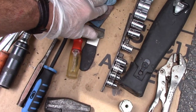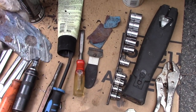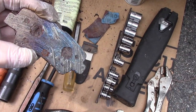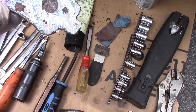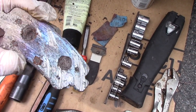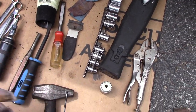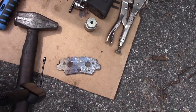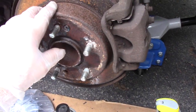Remember: on the other side, the brake pad actually slid down between the caliper and the rotor and locked up the wheel — that's why we can't get this vehicle down to the shop. That's why we have to change these calipers as well, because the other side overheated and it destroyed it.